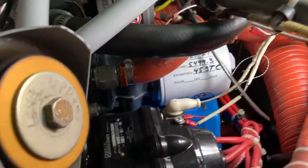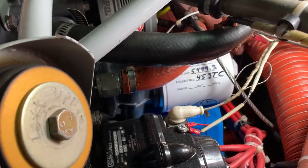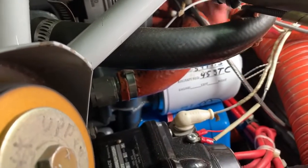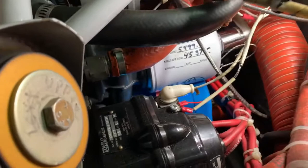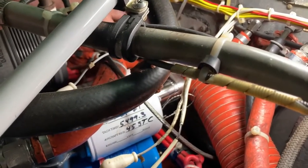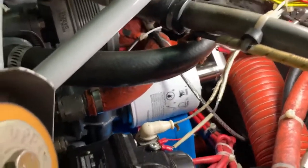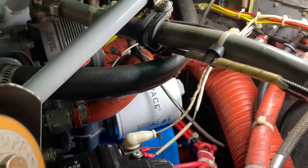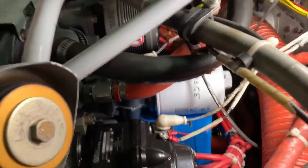It works best to kind of bend it back first. Then you'll need your one-inch socket — make sure your ratchet's set in the right direction for loosening. Lefty loosey, righty tighty. Sometimes a wrench works better because of clearance issues. This is the short filter — you'd have to check the manual to see if the Lycoming takes a long filter. Use a six-point socket to loosen it — six-point is always the best to avoid stripping. Once you get it a little loose you can see it just turns really easy.